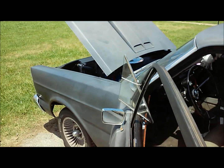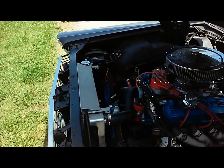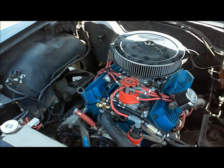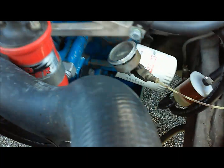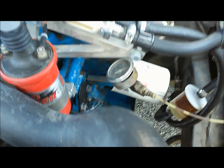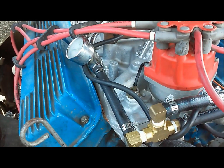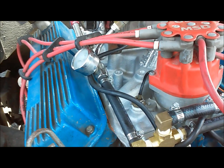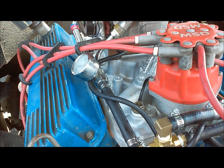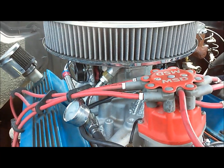I did try it on a mechanical pump and I don't recommend doing that. It just couldn't hold enough pressure. I have a big Holley pump and I had to make a plate to cover it up since I've been down here. With the return line, the mechanical pump just wouldn't cut it — it wouldn't build enough pressure. I was only bumping around 4 or 5 pounds and I like to run 7 pounds of pressure.